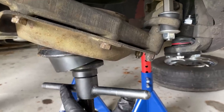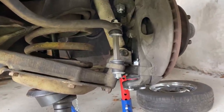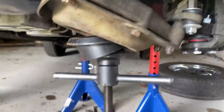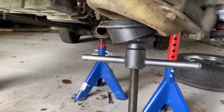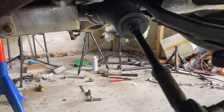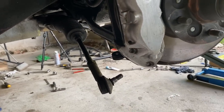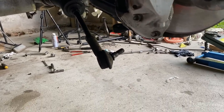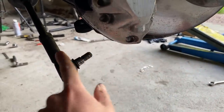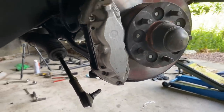These are all tightened and I've loosened the tool — there's no tension on it anymore. So with that, everything on this side is replaced. We're going to go through and torque everything. Before that, I'm going to put the exhaust back on and put the steering rack back on — that's pretty straightforward. Everything is back in: steering, all the hoses, exhaust, everything. The only job left to do besides torquing it all down is the tie rod ends. They're really, really stuck on here. So I'm going to just loosely put them back in here and then we'll get the induction heater out, heat them up, hopefully get them off, put new ones on, and then get the car back on the ground.